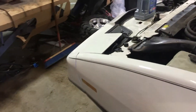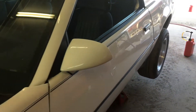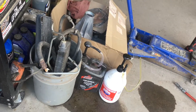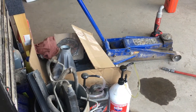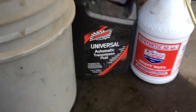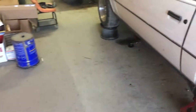Borg Warner actually recommended switching to 50-weight gear oil when Dexron 3 came out. It's technically called heavy-duty transmission lubricant — synthetic 50-weight with synthetic additives. I had some universal ATF that could have probably gone in there, but I went ahead and used that in the transfer case on my '83 instead.